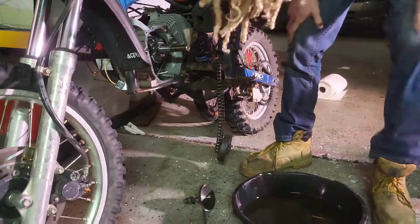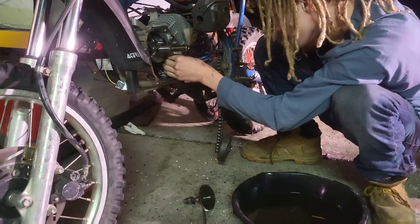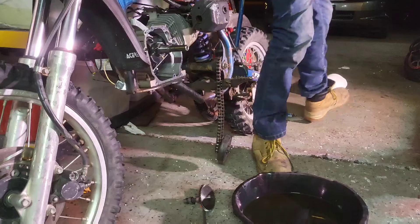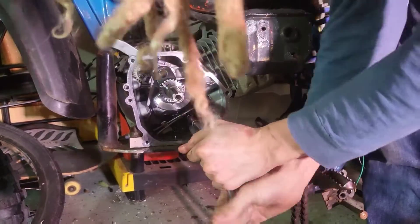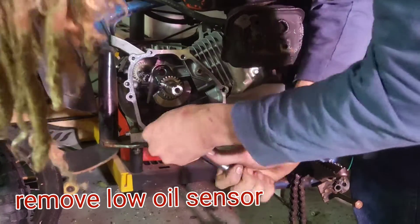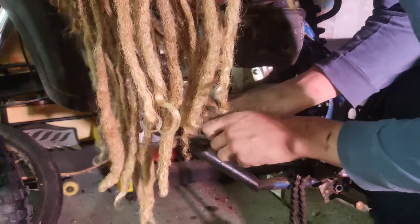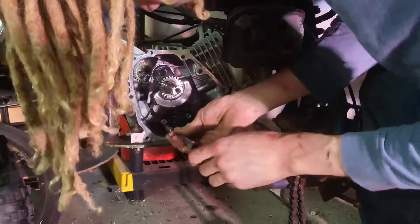Well, not including the fact that the cam came away — we'll still do 10 minutes. Anyway, moving on. I'm trying to do this as fast as possible; it's not going too great. This part is optional: remove the oil safety switch because it's just extra junk. As you can see, the pushrod fell out, so that's going to be a whole other issue to deal with. At least it doesn't look like he caused any damage by removing the top arm and trying to run it.